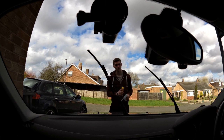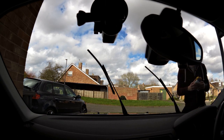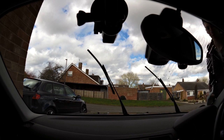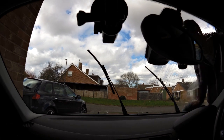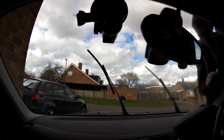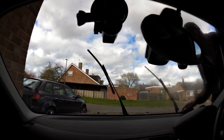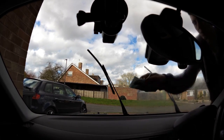Now I'm going to make sure it's nice and dry before applying. I'm going to pour it on the top of the windscreen, let it run down, catch it, and rub it in — exactly the same as cleaning the windows, applying it in circles. As you can see the liquid is much thinner than I first expected. Now I'm just going to go around and rub in little circles, making sure to get into all the gaps, going nice and close to the bottom, and trying to keep it off the rubber.